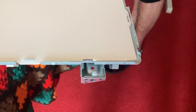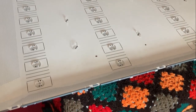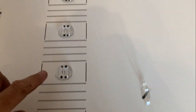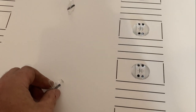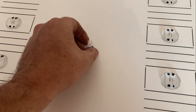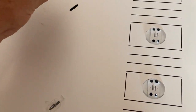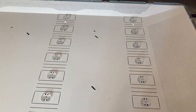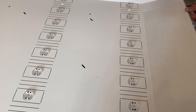We need to keep the order of the filters the same, so we're going to tape them together before removing them. Once the filters are removed, this is the base area we need to get into — these are the actual LEDs. It has standoffs for the filters which just twist and then pull out. We'll take all those out first.